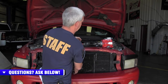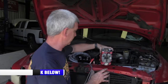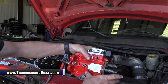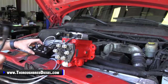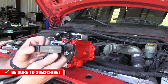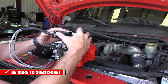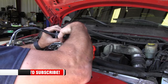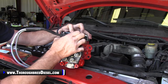The computer on the top of the VP44 is called the PSG — you'll hear us talk about the PSG quite a bit. This is the outward side where your fuel lines hook into the VP44. To hook this on, you just make sure that the bail is slid out completely, then slide this onto the PSG of the pump, and push the bail forward. The bail will engage the two tabs that are on the pump and lock it in there.